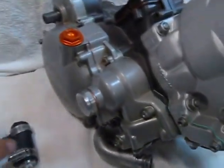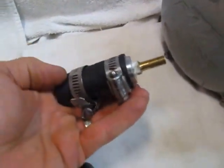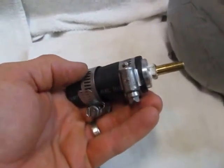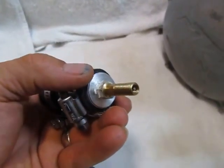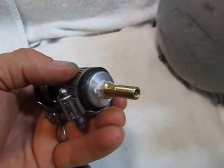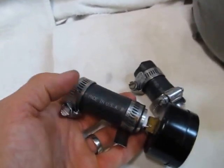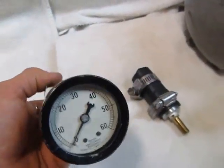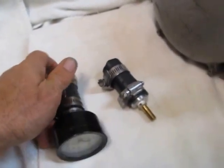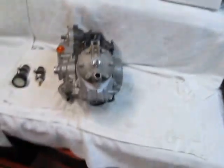Not too difficult to test. I made these little fixtures to test — a piece of heater hose there, a couple of hose clamps, a little plug there, and a Schrader valve with an eighth-inch NPT fitting. And another piece of heater hose, a couple more hose clamps, gauge right there. You can probably cobble that up pretty easily.